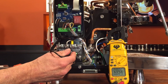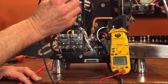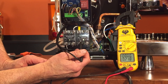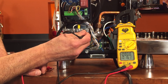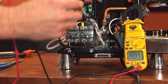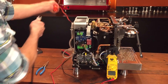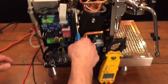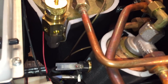So the next thing we want to check: let's say this light is on and you have power coming out of here but you don't have any heat. Next thing you want to do is check the high limit. Power is only going to come out when that light is on, so power comes in here, when the light goes on it sends power out of here up to the high limit. Once we've determined that we do have power coming out, we'll go up to the high limit, which is up here. Now I'm going to unplug the machine — a little safer working in there — and then I'll pull one of these wires off the high limit. There are two going to the high limit there.